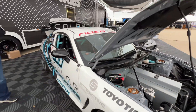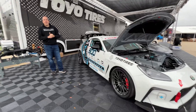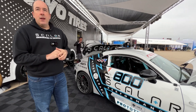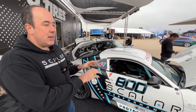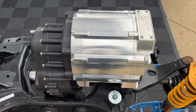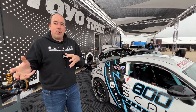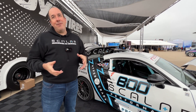What is the plan for this car — are you building tens, dozens, hundreds? It is very much a race car and we have probably another year of development to get it where we want it. Our goal is that if somebody buys it, it becomes the cheapest race car they've ever owned, because while the initial purchase price is going to be $210,000 US, there should be almost no maintenance. The motor has front and rear bearings with a 1,000-hour service interval. To get there, there's still a lot of software work — when we run on track, one of us is always on a laptop live-connected to the car making adjustments.